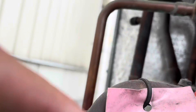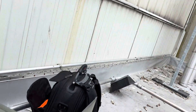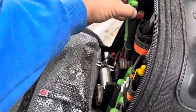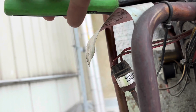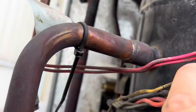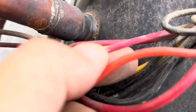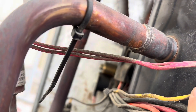So we do have - look at this right here. I could see that being a rub out. We're going to cut this zip tie. Looks like somebody put that zip tie there to prevent a rub out and they may be adversely causing one. So these two red wires and we have a yellow and a black that make up our pressure switches. They are definitely pinched, but they don't look like they're down to bare.